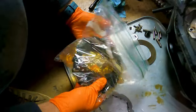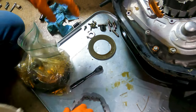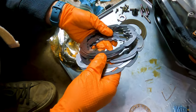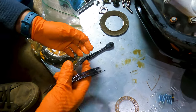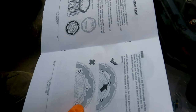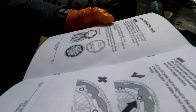Flip the stack over in the oil here, spread the plates a bit — I think this is wet enough. There's a difference in these plates: there's one that's a different thickness and they also go in a specific orientation. I was hoping they'd be labeled. According to the instructions, the Recluse steel drive plate goes first — install the 1mm thick drive plate. The orientation shown in the diagram goes into the basket, and all drive plates follow this orientation.